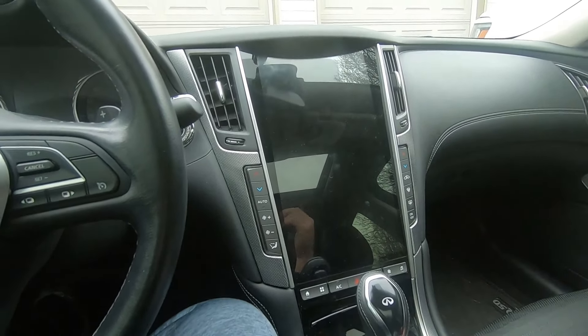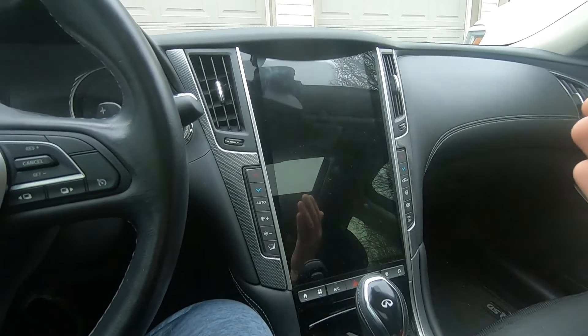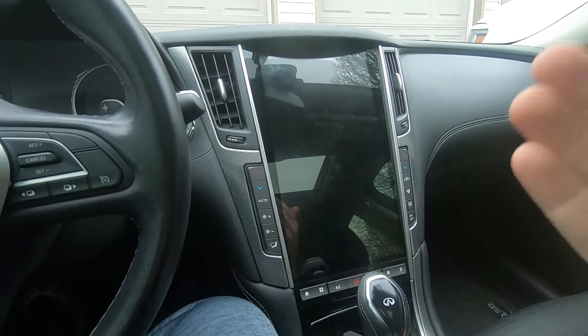You can't just swap out that DCU — it's specific to the options of your car. My DCU had four camera inputs because I have 360-view cameras. If you have navigation, things like that, and you get another DCU, you might have to get it reprogrammed by Infiniti. I've gotten a lot of questions asking 'will this work if my screens don't work?' and the answer is possibly, but probably not. It depends on the depth of your issues.